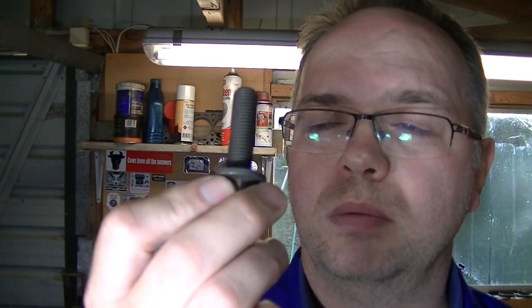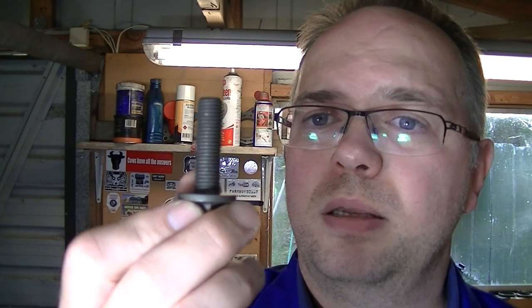So this is what the bolt should look like — this is the brand new one. There's nothing overly special. There shouldn't be any Loctite on it; it's only tightened to an oiled torque of 100Nm. So this really shouldn't have been a problem.